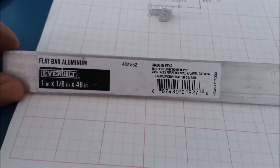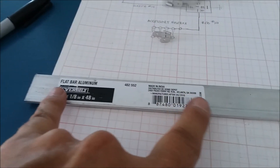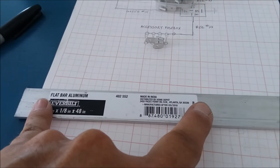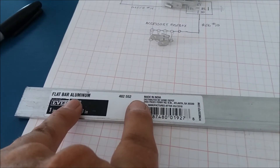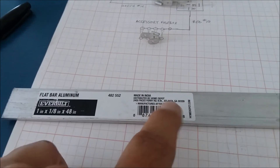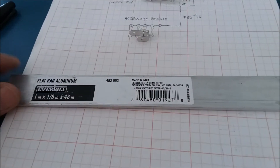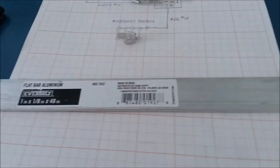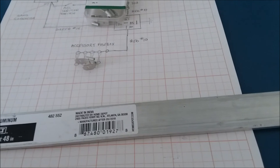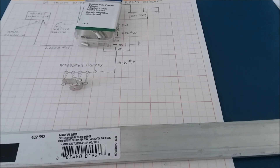The flat aluminum bar I got from Home Depot. I measured the two screws for the back of the glove box mount, then two more screws to mount the fuse box, and one more to mount the relay — all done with machine screws. You don't want to try to tap fine thread into this aluminum because it won't hold. If this was helpful and you learned something, I appreciate a like, subscribe, or comment. Thank you for watching.